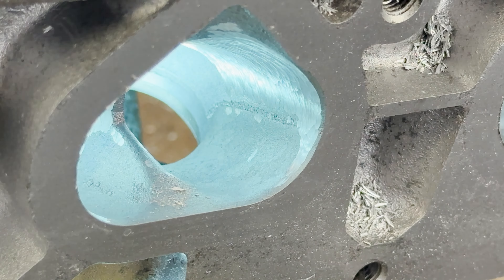These are the short turns. Now on the top of the short turn there is a gigantic ridge — basically it goes flat, then to a ridge, and then to the turn, although I've kind of softened these from doing it on the other side. Here is what I was talking about when you can make it wider — we're going to make it wider on the short turn into the bowl area on each side, and then we're going to shape the short turn. You'll also notice that this side is higher than this side, and we're going to keep that shape and make it so the air just flows well.